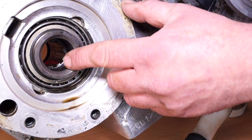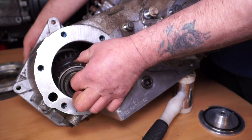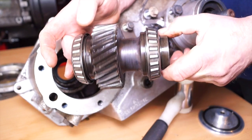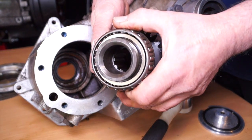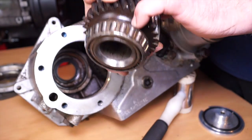The components of the transfer box have been cleaned thoroughly so you can see the condition of the input gear. I'll take this out right now and show you that this hasn't got any cross drillings in it, and the condition of the splines are in very good condition. You can see that very clearly here, so the oil feed plate has been working.